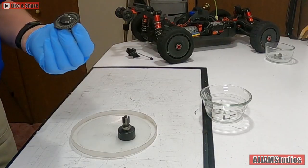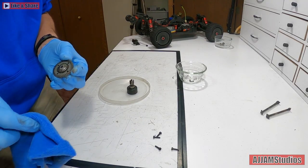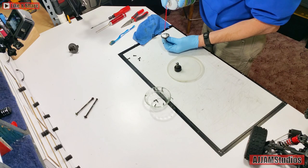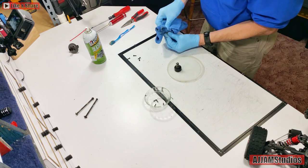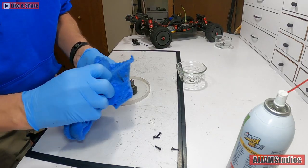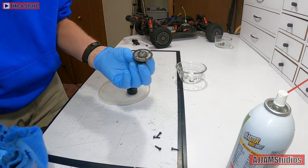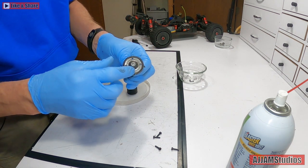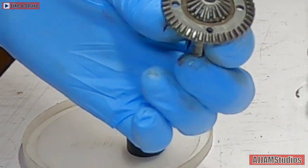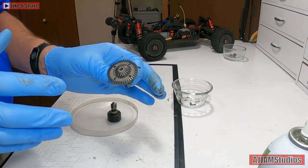Let's drop this one. We'll take our rag and clean this off. Now let's spray a little silicone lube on there just to clean it up. It's surprising how that silicone lube actually gets all that off - it does a really good job, and it's a lubricant, not a stripper, so it won't affect the gasket. If you look down in here right on this edge, there's the gasket that goes around - you want to keep that in place and make sure you get it right back in the same spot when you put it back together.